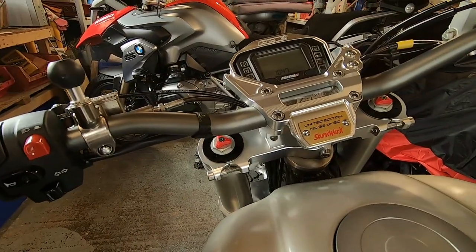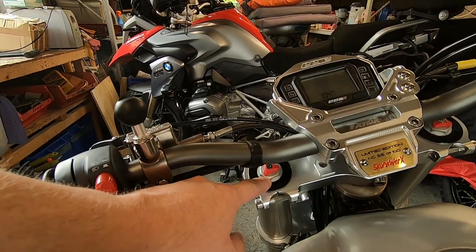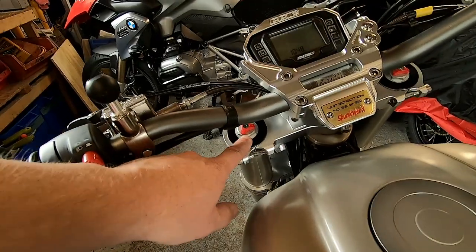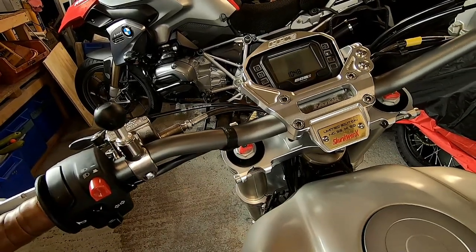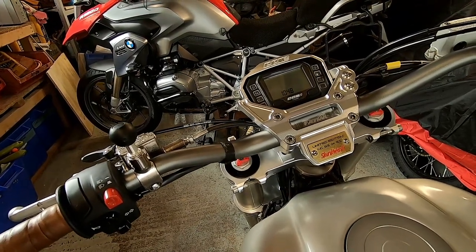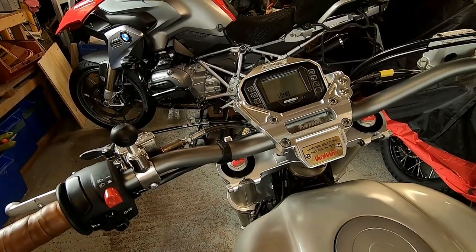As you can see, just there on the top of the CCM front forks, you've got a 24mm nut and you've also got a three-pronged adjuster. The 24mm nut is for the preload of the springs inside, and the three-pronged adjuster is for rebound. What we need to do with the 24mm nut is wind it all the way out and then go back in clockwise three full turns. The three-pronged adjuster is basically a needle valve which stops the oil from escaping back in — controlling the rebound. Dial that all the way in, and then anti-clockwise ten clicks out, which will slow the rebound down so it's not just bouncing around like a jack in the box.